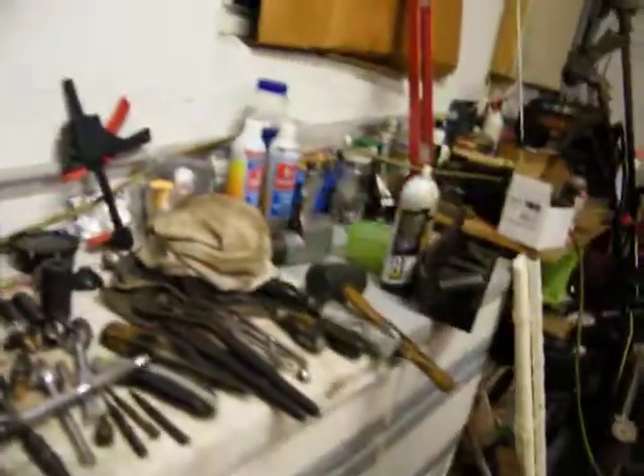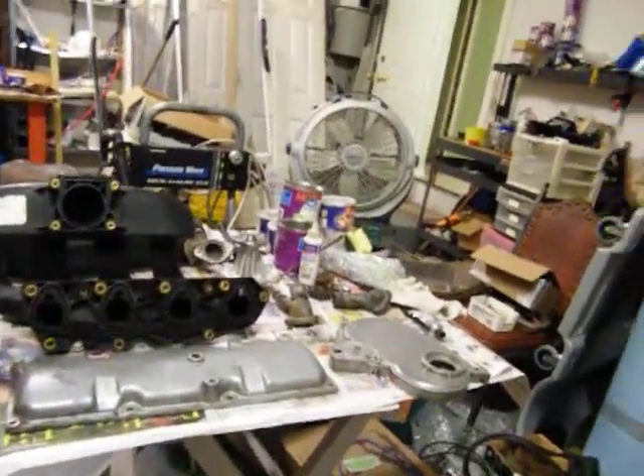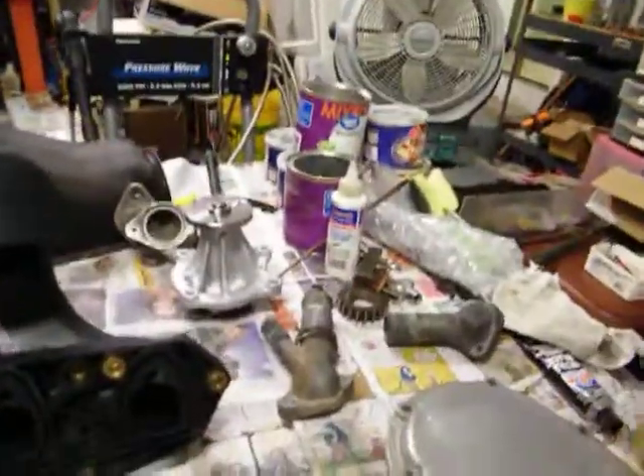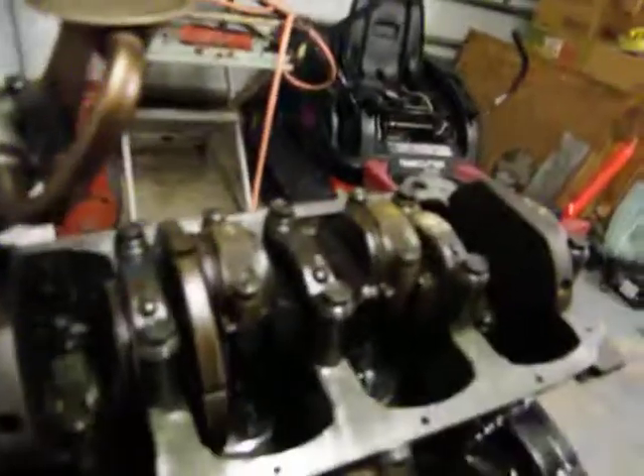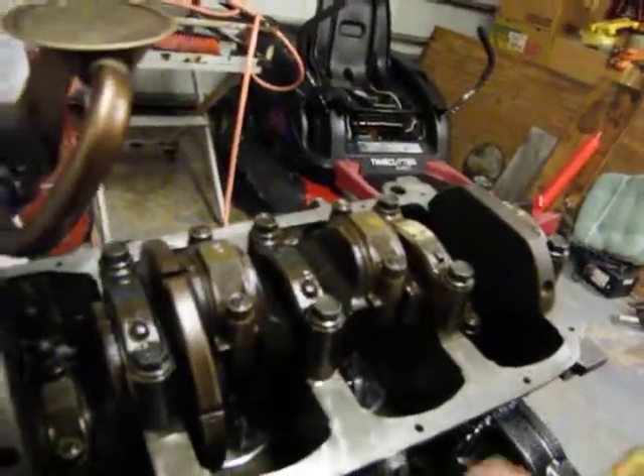We are getting so close now. If I don't run into any more problems — cause I'm literally at the point where I want to right now — I'm putting a quart of oil in this thing. I want to put some in each one of the cylinders from the bottom and put them back at the halfway point, where they're all about halfway down the cylinders. Let oil soak from this side down through the rings, and then when I flip it over I'll have the oil pan on so I won't lose it. Then I'll put some in from the top.